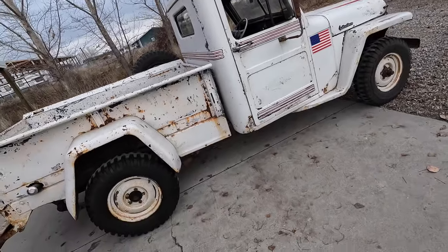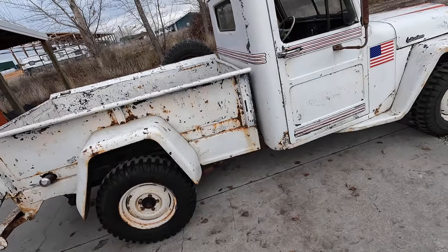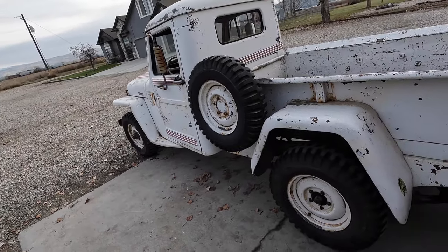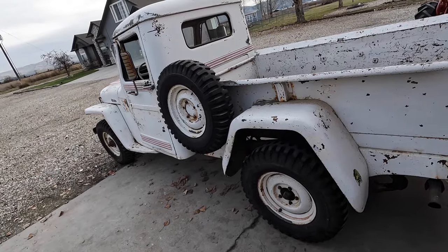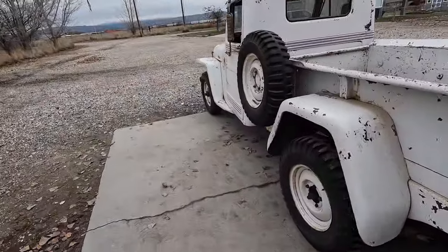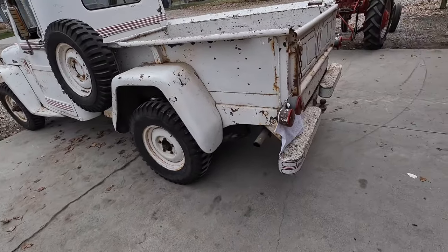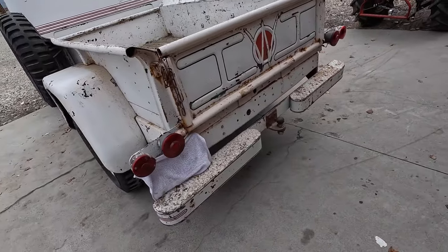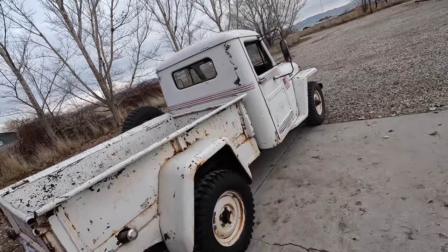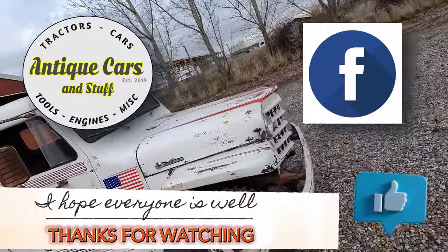The pedal feels good to me. We have no signs of leaking at the wheel cylinders or the master cylinder. The truck does stop when you press on the pedal. You just don't know what you're going to find in there — it could be a bunch of rusty components that everything will need to be replaced, or what I'm hoping is that it has had a brake job sometime in the last 10 or 20 years and we can kind of work with what we got. So it looks like we'll need to get a new brake switch for the master cylinder, new blinker relay, and I'll probably get a couple extra bulbs so we can replace the ones in the outside lights as well, because I really like how the inside ones are nice and bright now. Thanks everybody for watching, I hope everybody has a healthy, safe, and enjoyable Christmas and New Year.